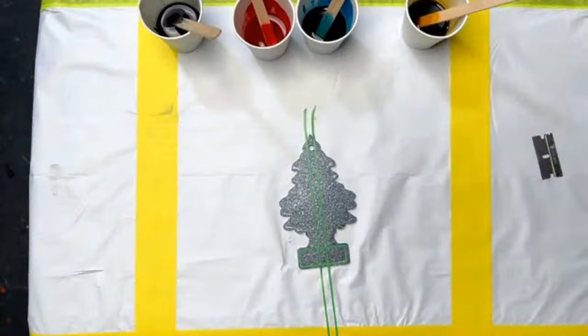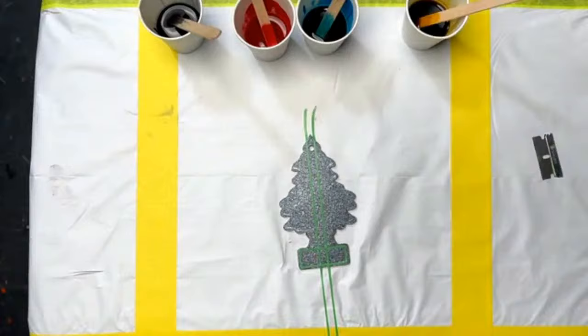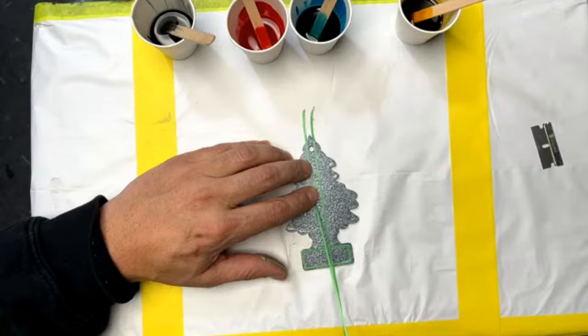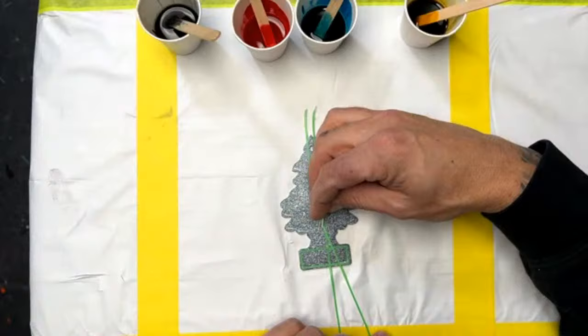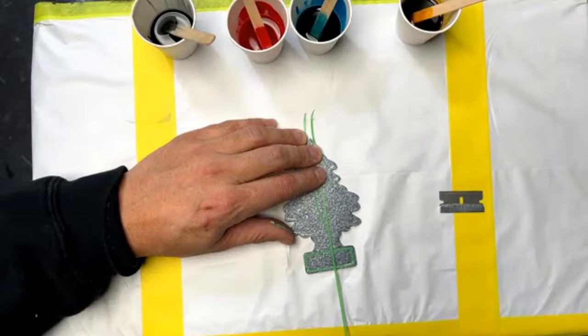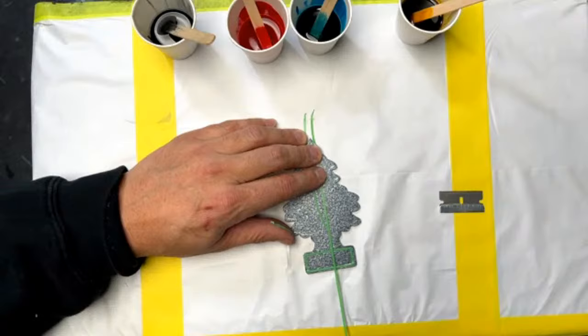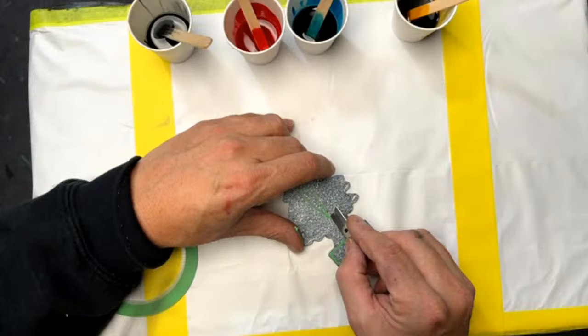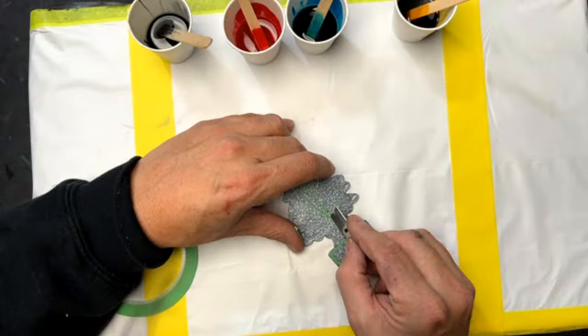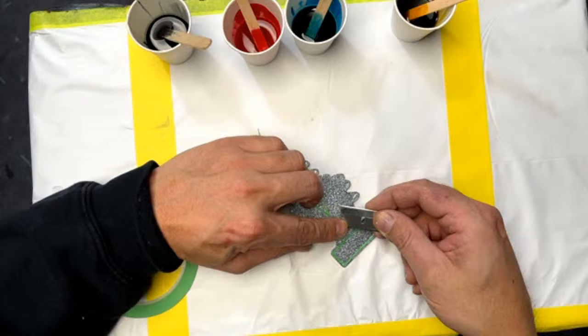What causes candy to peel with paint? I made sure everything was properly sanded with 600 and cleaned — seems like the blue candy peels the worst. A lot of times that would be due to oversaturation. I see that happen quite a bit. Oversaturation of the candies could cause them to have problems with adhering, so you might want to look at that — just go slower and spray super slow. When you use lace, is it material, plastic, or cloth? You can use a vinyl material but most people just use a cloth — or a curtain or a tablecloth. You'll find a lot of cool designs in tablecloths that are that knit style.